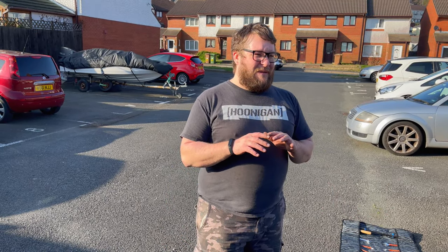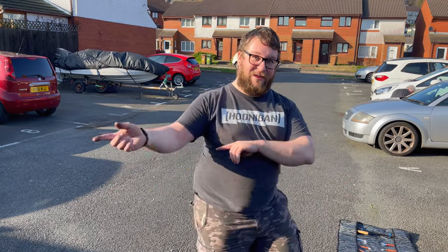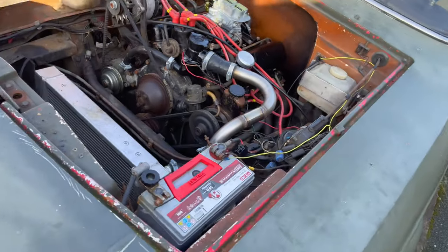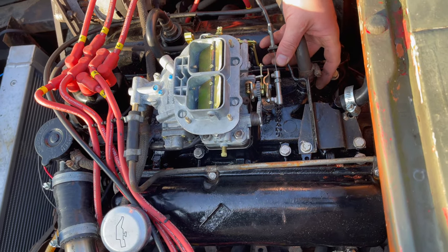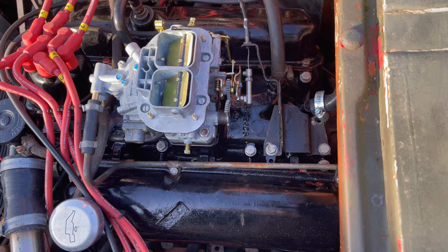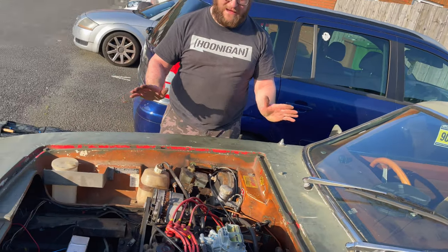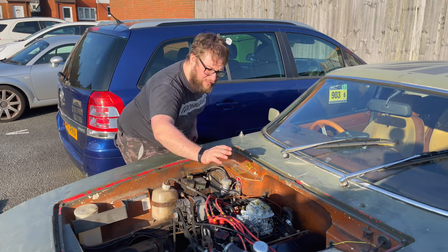This must be the longest episode ever to film. I got the new inlet manifold maybe three months ago, then scraped it down and painted it up — which you would have seen at the beginning of this episode — put the engine back together, and here we are. Father is on the camera today, mainly here because of the throttle linkage. You can see this is not a standard setup — we've had to use the original plate for the throttle cable to go in, and as it pulls back on that it actuates the throttle. It works, sort of — it does stick open at wide-open throttle.